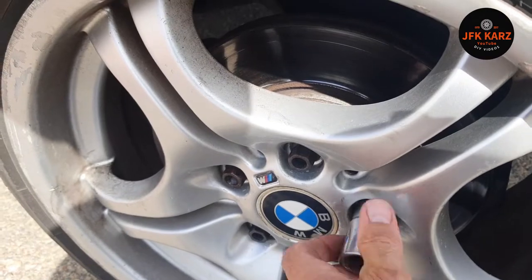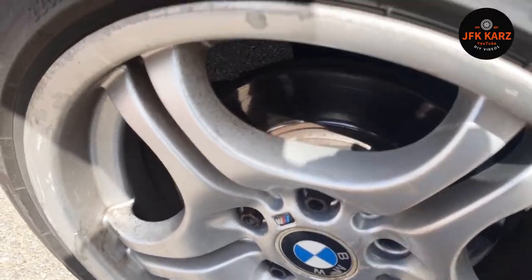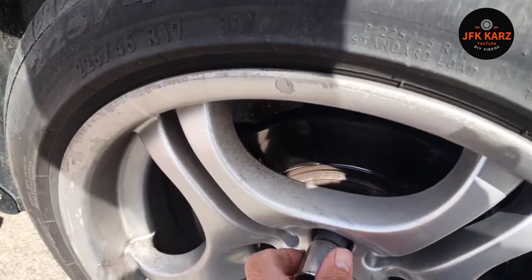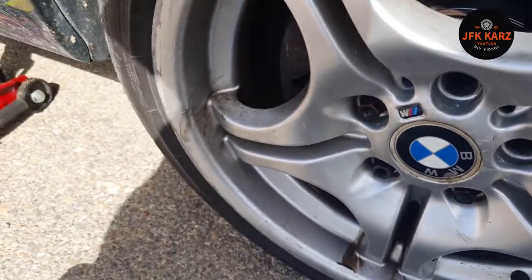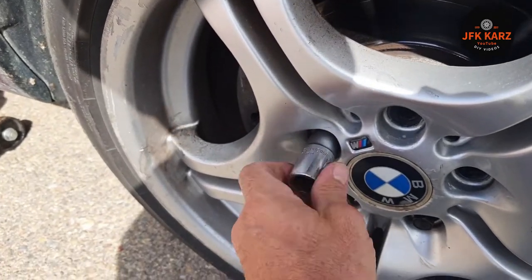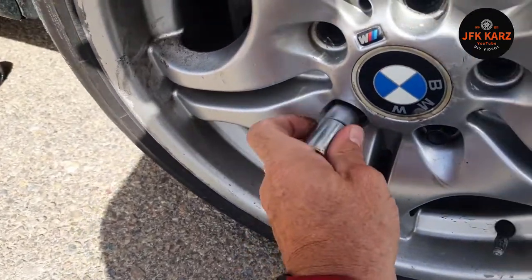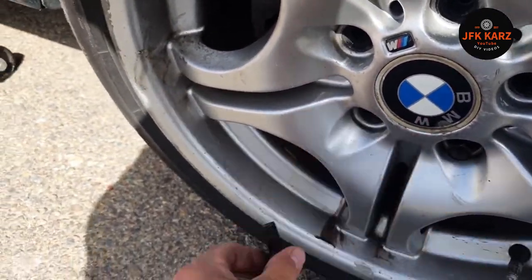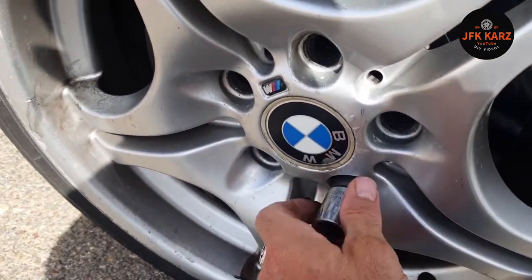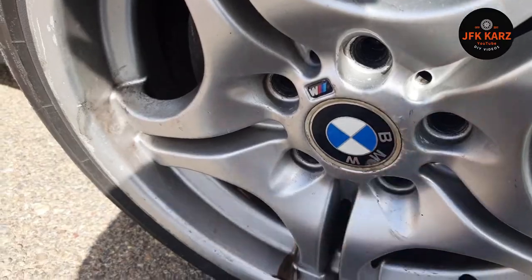Because you've already slackened them off, you can now take the bolts out. Most cars have four — German cars seem to have five, which is a bit more sensible and gives you a bit more extra security. You may have a locking wheel nut, so obviously you'll need to find that key — usually in the boot or centre console, that's where people seem to stash them.